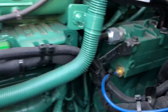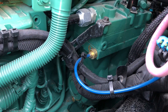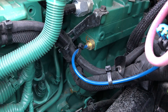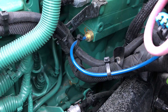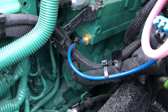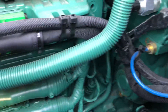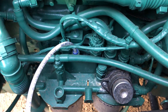Unlike Mack, this truck has a dual piston compressor. I like this compressor because it builds air really fast compared to Freightliner, Cummins, and Mack — this compressor is faster because it has two pistons. This compressor has been standard on Volvo engines since around 2009.